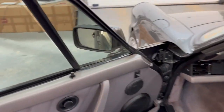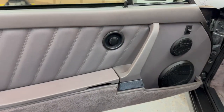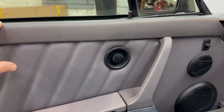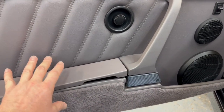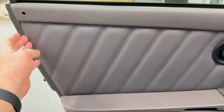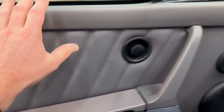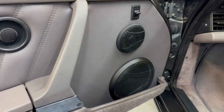You've got to be super careful with these older cars. We've done all the usual work on the door — we spent quite a bit of time getting the door soundproofed and in the best acoustic shape as we possibly can. Things like the membranes were missing so we've created new membranes, lots of the fixings were missing so we've epoxied new panel clips in. We've tried to get it back together better than it was when it came in.